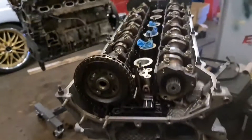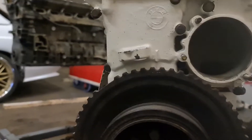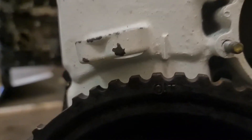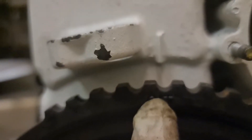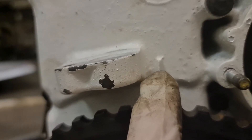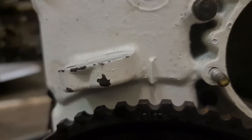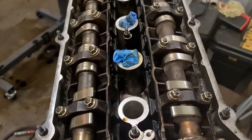I've just stuck the crank pulley wheel on so I can get the top dead center. Basically rotate the engine clockwise until you line up the top dead center mark with the top dead center mark on the block — you can see the top dead center mark on the crank pulley and the top dead center mark on the block itself. Get that in place, then what we also need is our cams.